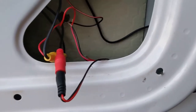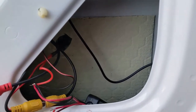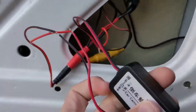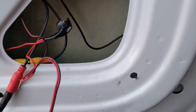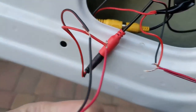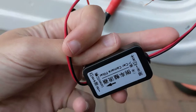If you've got to the stage where you've actually plugged your power cable into your camera, you basically want to cut into that power cable and insert your voltage regulator into it. You'll notice this has got an in and an out on it, so you want the in side to be coming from your live and your out to go to the camera. I've just twisted these cables in place, and now I'm going to solder these in place and then start the van up to see if the signal is any better.